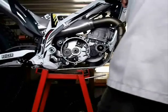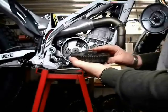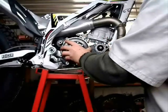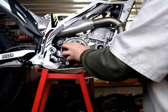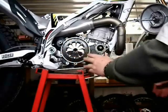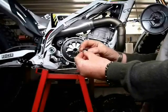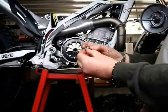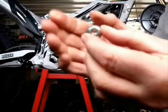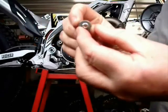Now we will install the clutch — put it back on the bike. You just kind of plug it in there, then a little bit of rotating and wiggling and you'll feel it fall into place. In the center is that large bolt with the washer or bushing piece. That bolt is hollow — it's actually a vent to equalize pressure in the gearbox and clutch cover area.